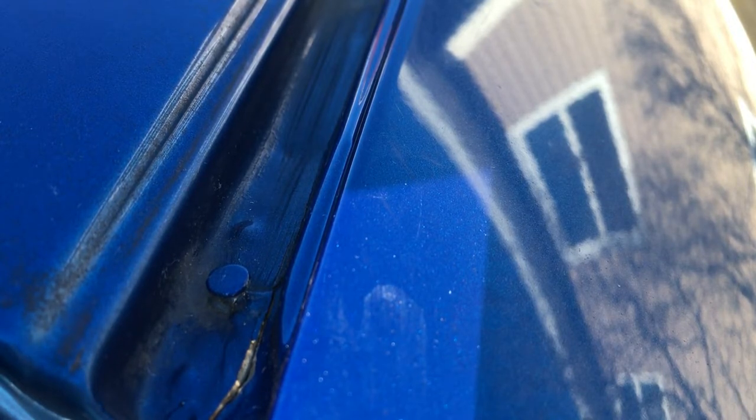With the cracks in our seam sealer identified, we can go ahead and give the channel a quick clean with a damp cloth, giving it some time to dry before applying our product. Using an artist brush, we can fill the channel and slowly brush the cracks.